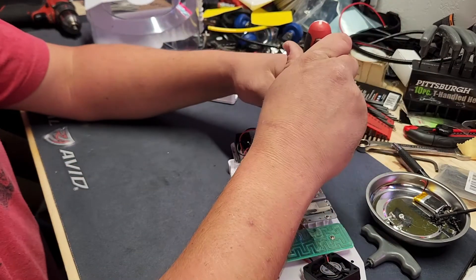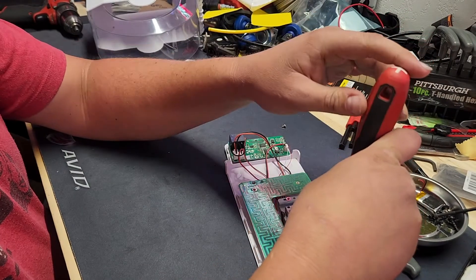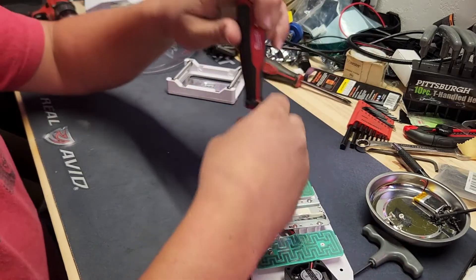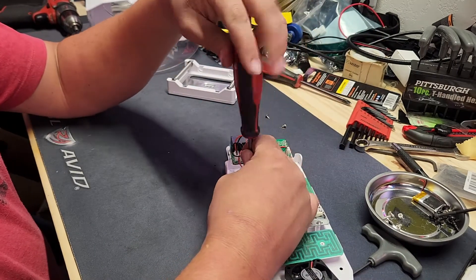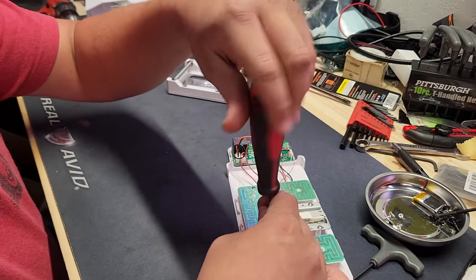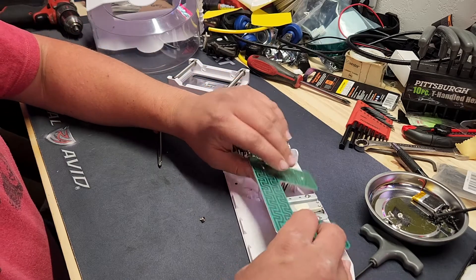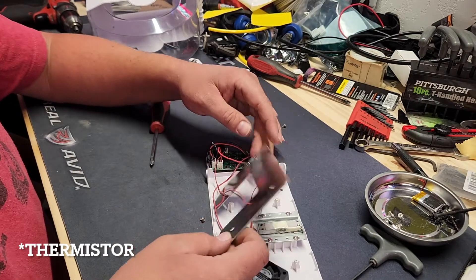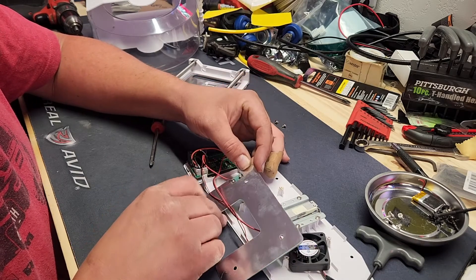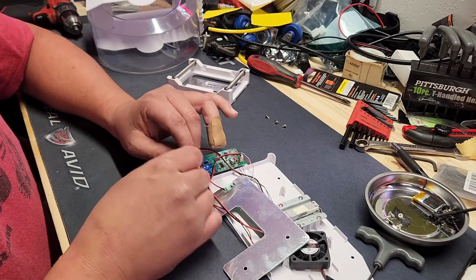I'm going to guess this thing is just disconnected from underneath the side here — either got too hot and burned the solder right out, or this resistive heating element is just toast. We will see in just a second. Hopefully we can just solder it back on. Okay, let's see what we're dealing with here. We got to be careful not to pull on our thermocouple wires. Oh yeah, it got hot enough to melt right out of there. This wire is scorched as well. I'm wondering if it's going to be worth it to maybe just put a bigger wire on here — yeah, this is all scorched.